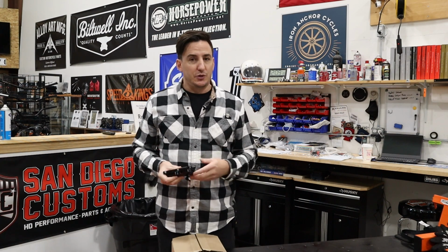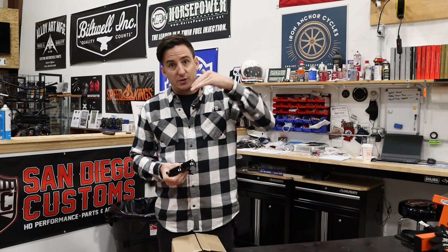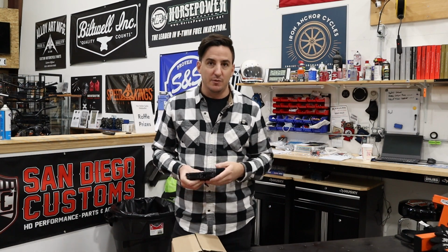So what's the solution to that problem? Well, for Harley and the manufacturer, there really isn't a better solution because the EPA won't allow them to vent the crankcase pressure to the atmosphere. So that's why it recirculates back through your air cleaner and ultimately into your motor.